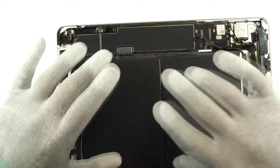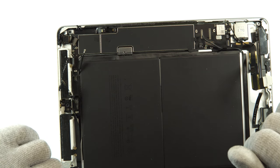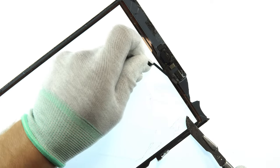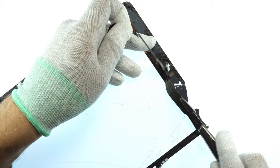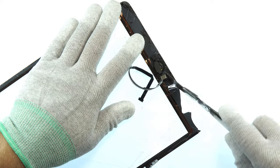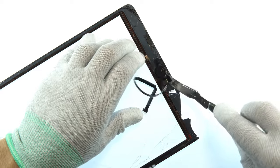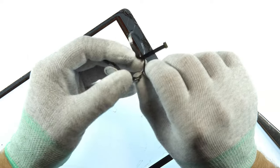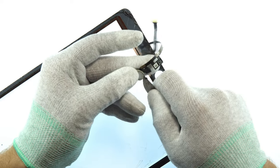Next step will be to heat up the device. I'll first clean up the space so no glass is in the way, and show you how to remove the home button from the broken touchscreen. Pull the flex cable very carefully, then take the scalpel and go underneath the flex cable, lifting it very gently. Go underneath here and here — this will come up. Then go underneath the home button and pull it up — the flex cable is removed. If there's glass left on the home button, take the scalpel and remove it.